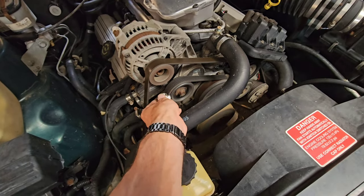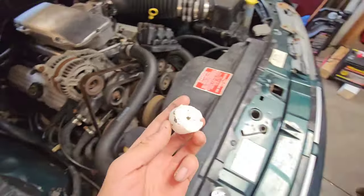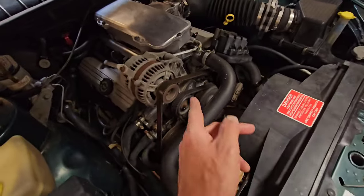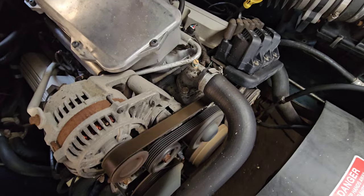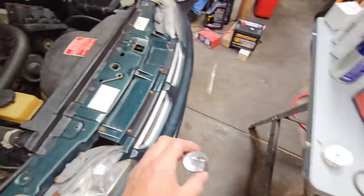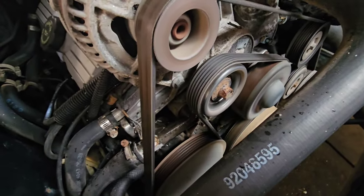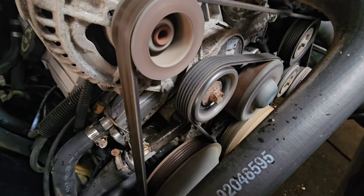So just dry it out a little bit with all the degreaser, but hit it with a bit of wax, T-light candle in this scenario, don't tell Helena, and bingo, no more squeaking. So there we go, works a charm. I'm just standing here listening after we put that wax on the dry belt there, and it's quieting it down quite a lot. No more squeaking as you can hear.